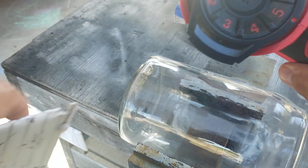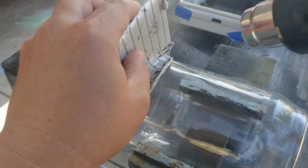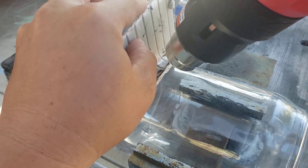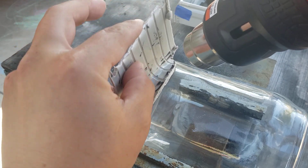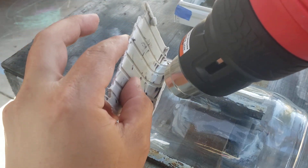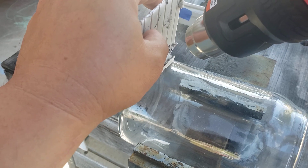Setting five is roughly about 650 degrees. Aim it at the part you're trying to roll or fold — not the whole thing, just the specific area. Hold it about two inches away from the part and just work it. After a while you'll start smelling the plastic, and that means you've got it just right.